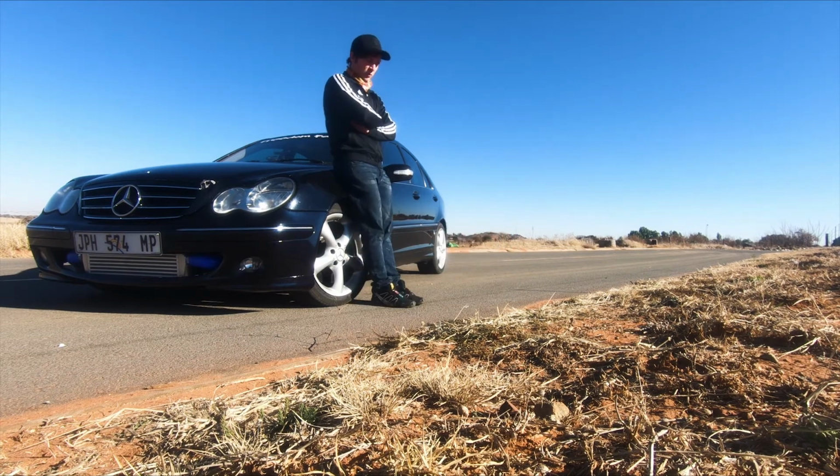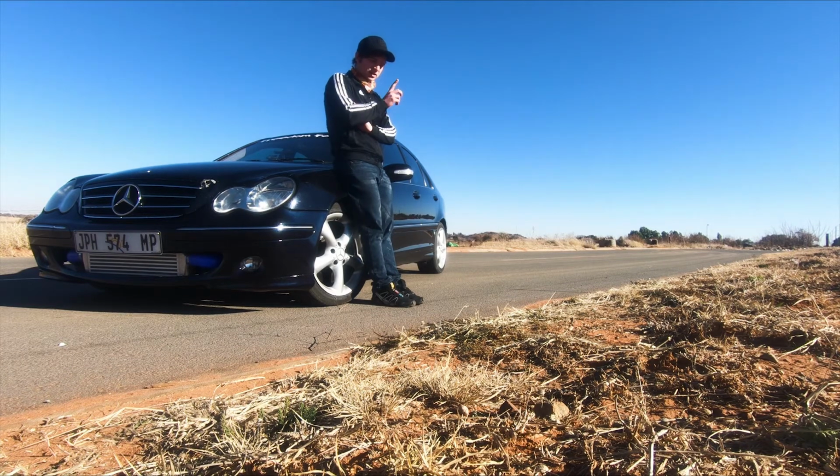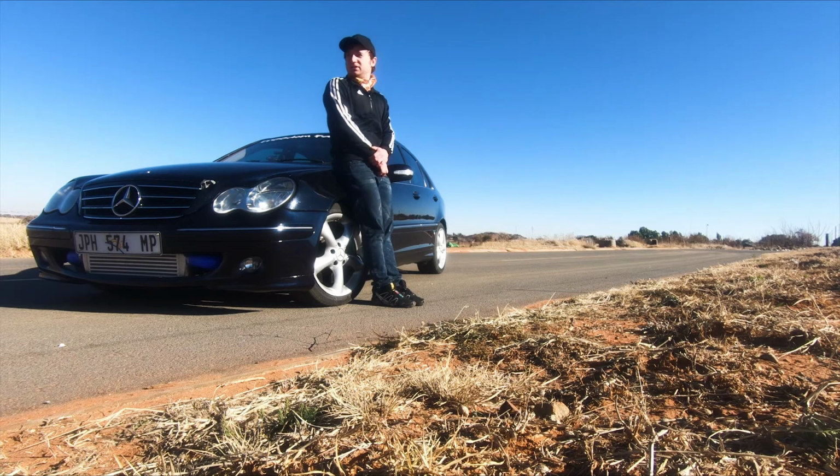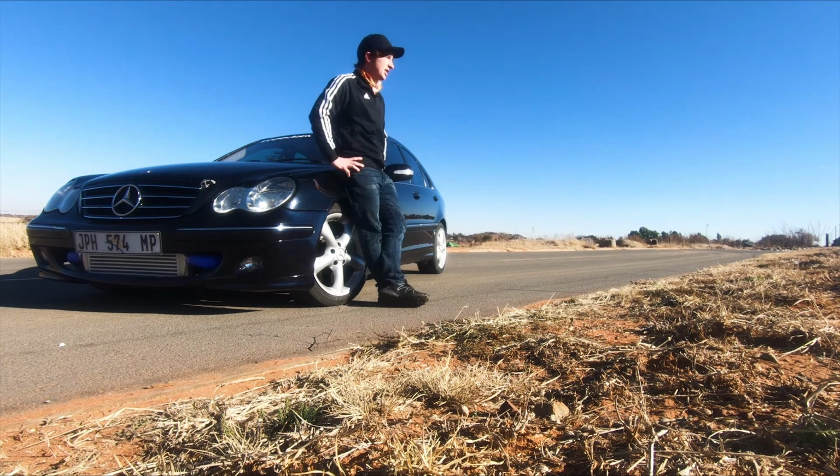What was happening was the mass airflow sensor was seeing, it measures in g/s, so I think it's grams per second, the mass airflow sensor. So it was reading about 20, 21 at idle. That normally should be like under 5, but mine was idling at around 20. So it was just dumping fuel into the engine. So I just connected the bypass valve again, and now I can feel what the supercharger pulley is actually doing.